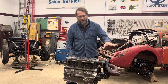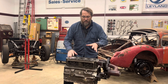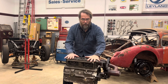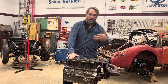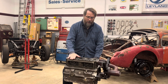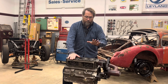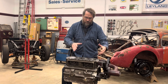Through all the confusion and calculations, I've decided to play it safe and basically build the same thing I had before. That way, if my old calculations were wrong and I'm actually closer to 9.8 to 1, then this will be 9.8 to 1 — which is close enough. But if the new calculations are wrong and it actually ends up at 9.6-something to 1, I'm not really giving up that much. The motor actually performed very well right up until it ate some lifters and chewed out all the bearings, so the performance was really good and I was happy with it.